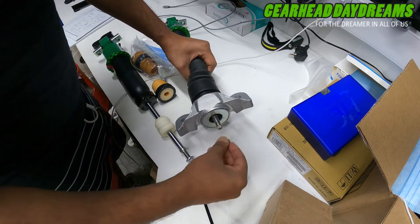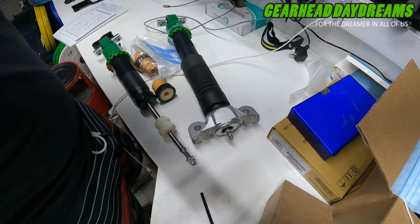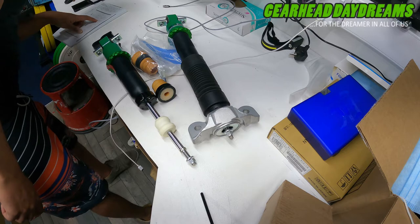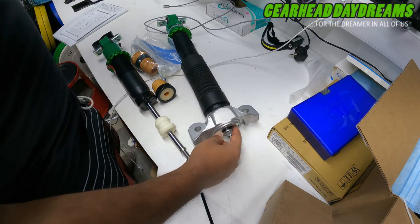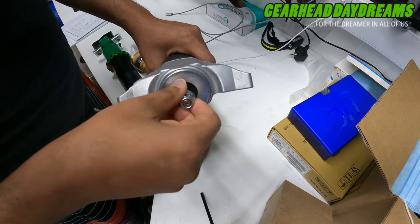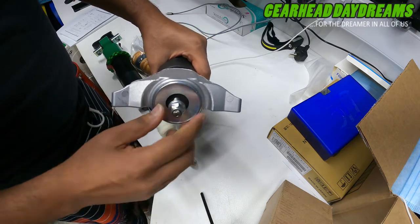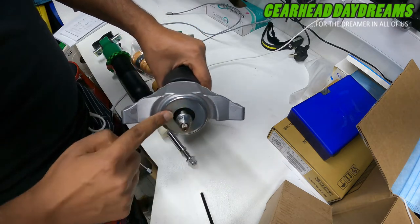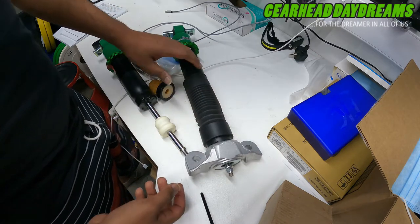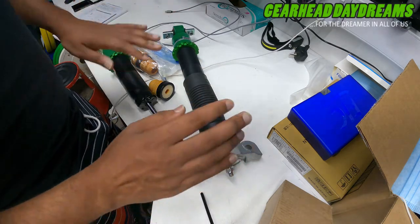Then you put the collar on, and then put this on like so. What you have to do is tighten the nut - it's a 14mm nut, already nylock, so you don't need threadlocker. I think the torque spec is 24.5 Newton meters - not a lot of torque. The problem is to get there you'll have to use an 8mm spanner to hold on to the flat, which means I need a crow's foot attachment to tighten this without the shaft spinning. Don't use an impact gun.